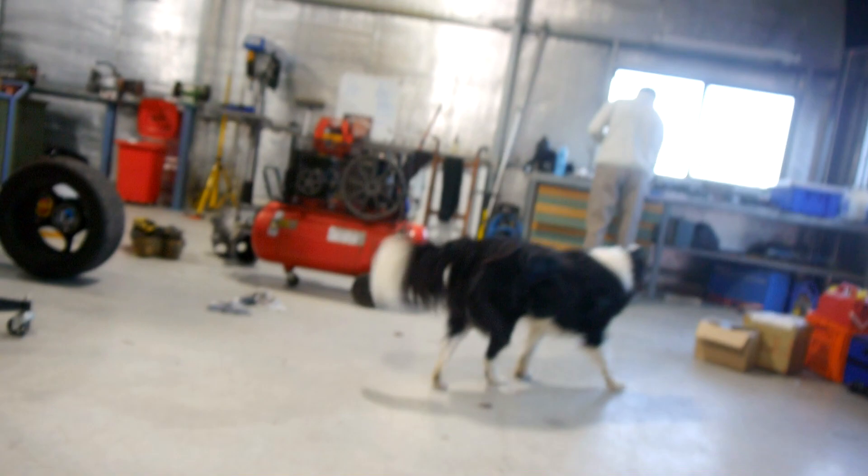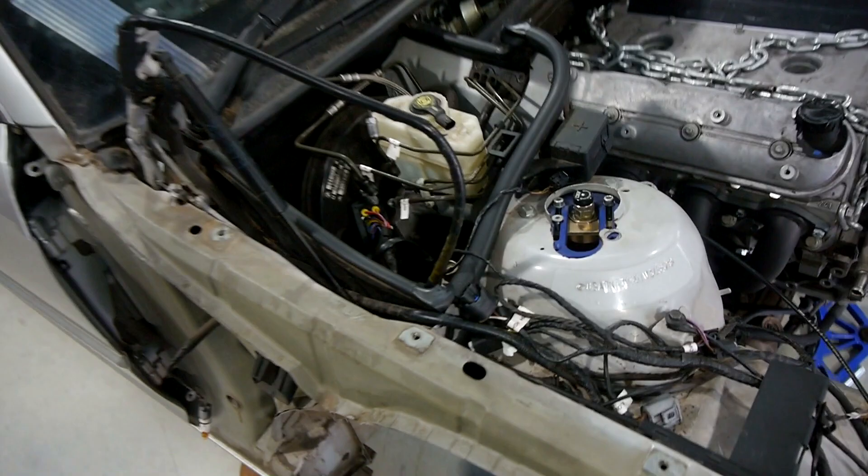We're back up the top of the hill here. I want to feel like I'm actually going to get something done to Smokey these holidays. I thought I might push through today and see if I can get all the front end back in the car. To do that I'm going to have to change these strut tops over and put the SLR versions in, take out the Wisefab on the passenger side, and then put both passenger and driver's side SLR gear in. I may even read the instructions — they've got a couple of pages there and I kind of feel like I probably should follow them.